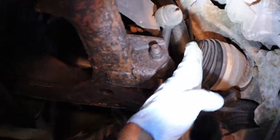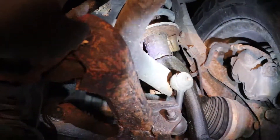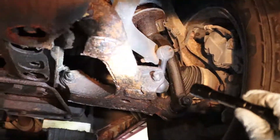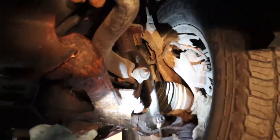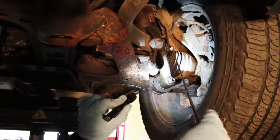It's obvious that this strut — the shock absorber — has just leaked the oil out. So this strut is actually not working at all. That's a clear sign that the shock absorber has leaked out the oil from inside.